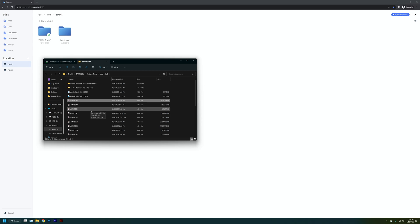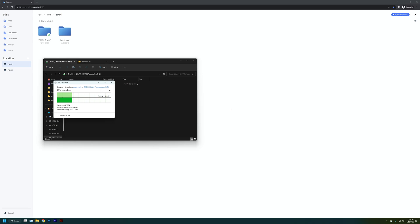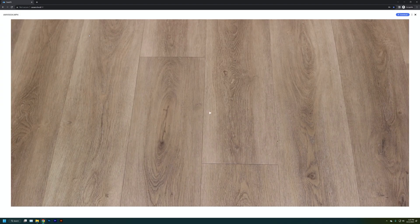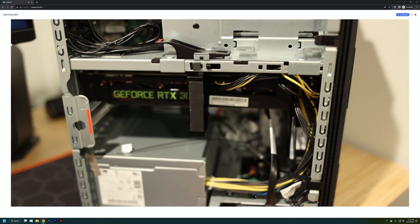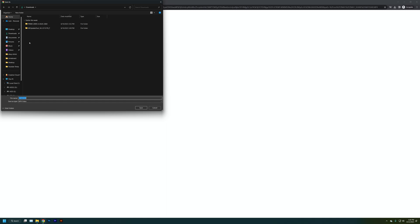Next step is making sure it actually works at the intended speeds. We're going to take some video files from a previous video and paste them into our Zima One Shared folder. We're getting that full one gigabit speed — 111 to 112 megabytes per second — which is awesome. That's all the speed you really need. When you click into the CasaOS web view, everything looks really good and playback is super smooth, just as you'd expect from a drive plugged directly into your PC.